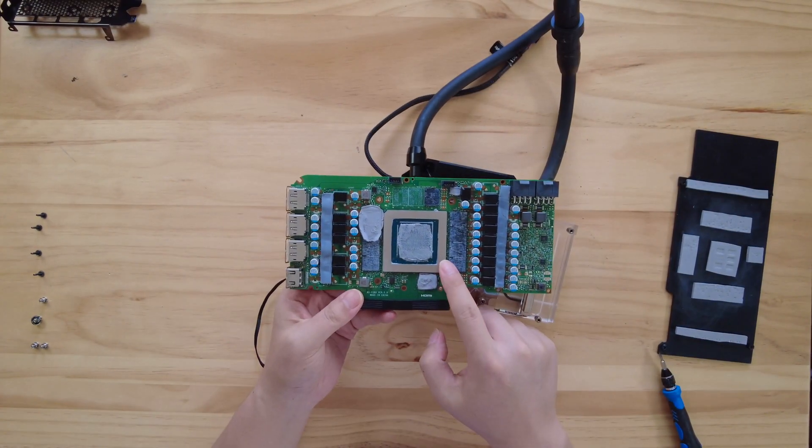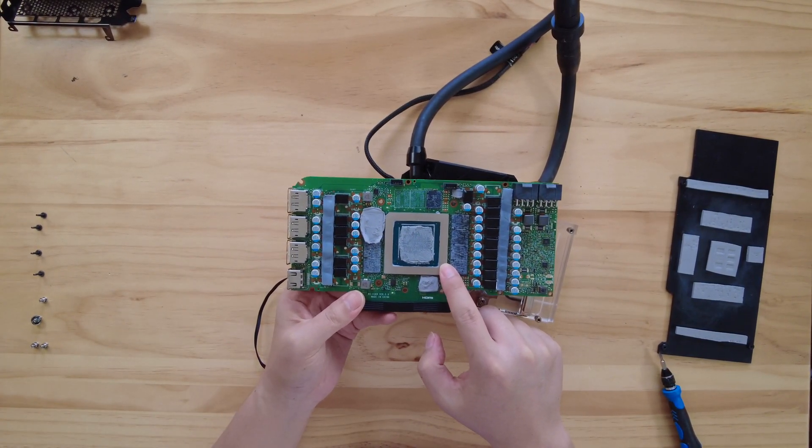Now, for the S-Wolf series not working properly, there are a few key items to pay attention to. First, the water block needs to have a really good contact with the PCB. If not, you will have temperature issues and your radiator will not blow hot air. Second, if your radiator or water block is blocked by some kind of item, then the water pump will not be able to push efficiently, and you will get very high temperatures. Third, if the water pump is faulty, then it cannot flow the water and leads to overheat.